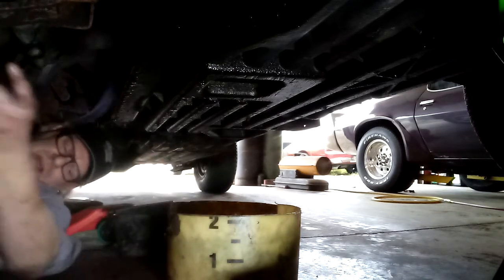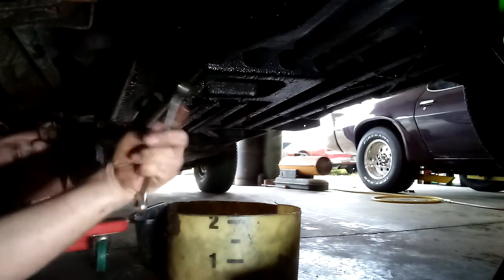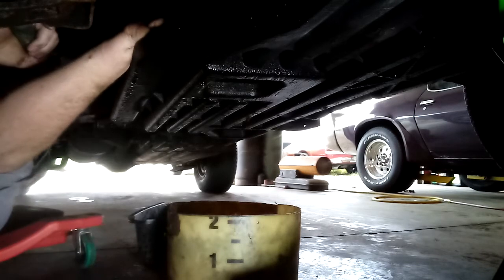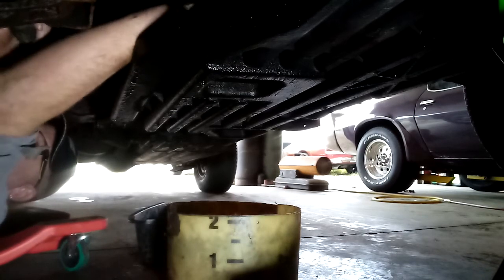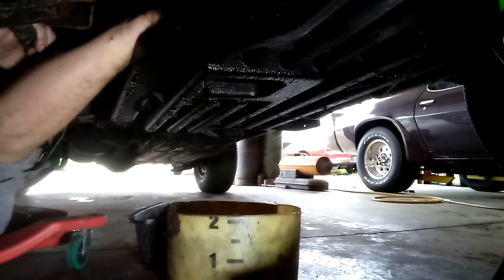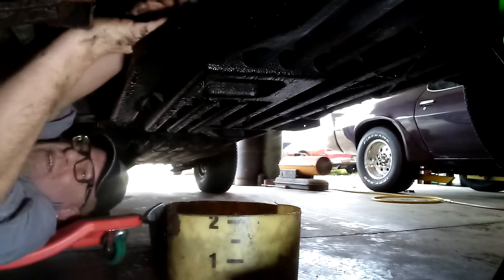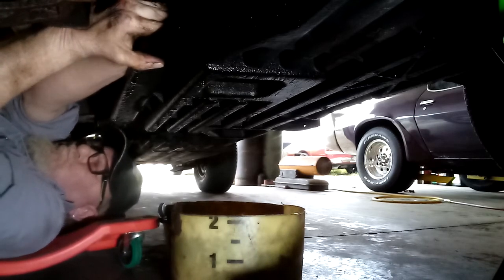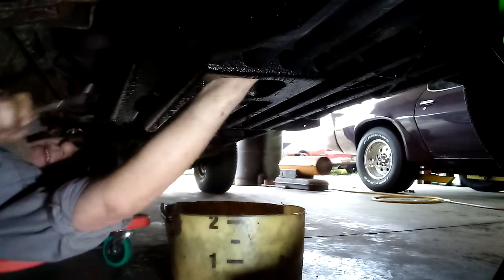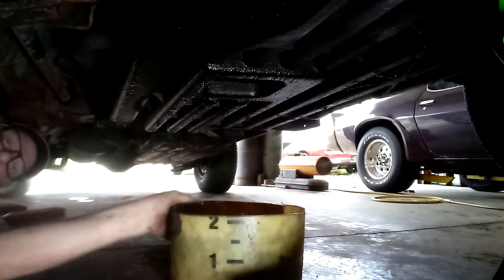Okay. Now the Durango, the 5.9, it's got an access hole right here. But you can actually go up through here. It's 5/8. Remember, lefty loosey, righty tighty. Man, it's on there too. Get a good grip. Don't bust it. Ah, there it goes. Yeah, that's on there. Now, hopefully it don't shoot all over this shield and make a mess. It probably will.